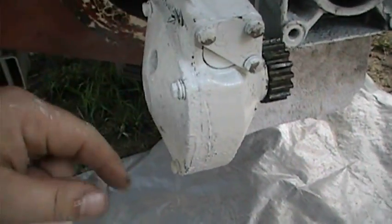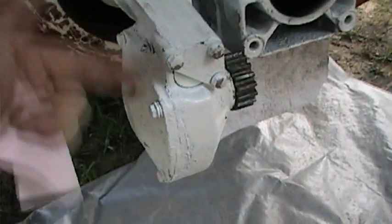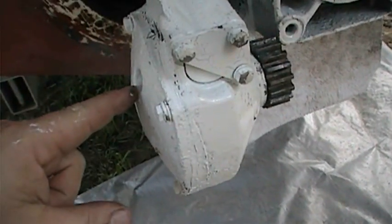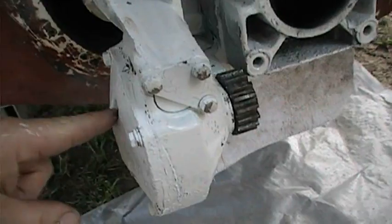By removing these three and doing a light tap right up in here — I've got to replace a few of the seals that are in here and secure this up a little bit. I'm going to pack it with grease; it's got oil in it right now, but a better standard procedure is probably to pack it with grease.